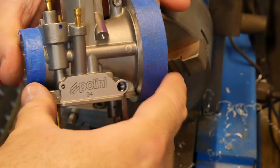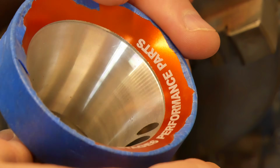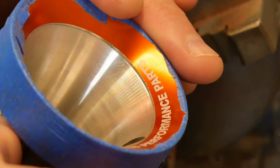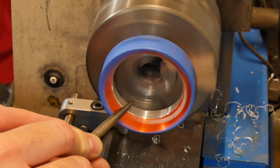It finally fit, but I hadn't wanted to cut the lip very thin since there wasn't much of a lip left after matching the carburetor's mouth, so it didn't leave a very smooth transition. I used a file and then sandpaper to shape the lip a bit better.